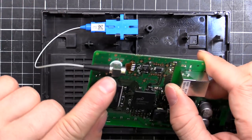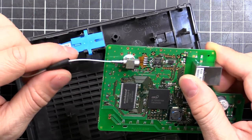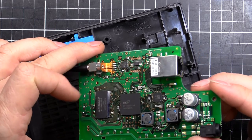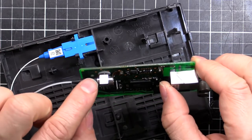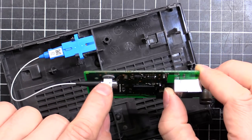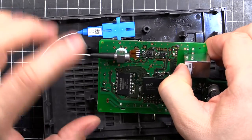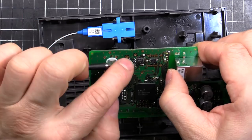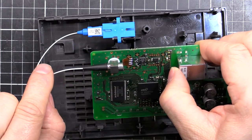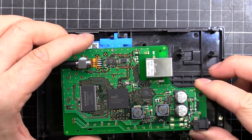That's connected to this little metal block. The fiber comes in with a strain relief boot and plugs straight in. We've got these pads — like a mylar flex cable — soldered down going up to the laser. In that block there's going to be a prism or something, so the laser shoots straight through for the transmit, and the receiver signal gets reflected down into a little phototransistor soldered to the PCB. It's the same way they do it in a CD player — the laser and phototransistor use a series of mirrors and prisms to bounce out one aperture, hit the disc, and come back the same way to get detected.